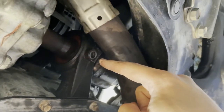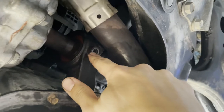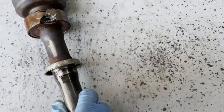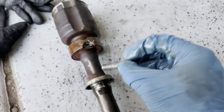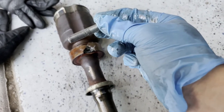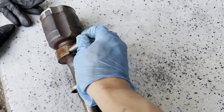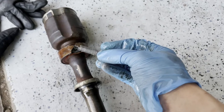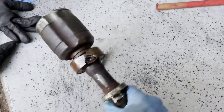The other way people get it out is to find a bolt that is way longer and stronger with the same thread pitch as the one that's supposed to stop the outer race, put some anti-seize on it so it doesn't wreck the threads completely, and screw it in. There is a chance it will mess up the threads, but the outer race rusts in there anyway. You screw that bolt in — you'll hear some cracks — just keep going, it gets easier. Back it out and you're done. Three days later, finally got that inner half shaft out.